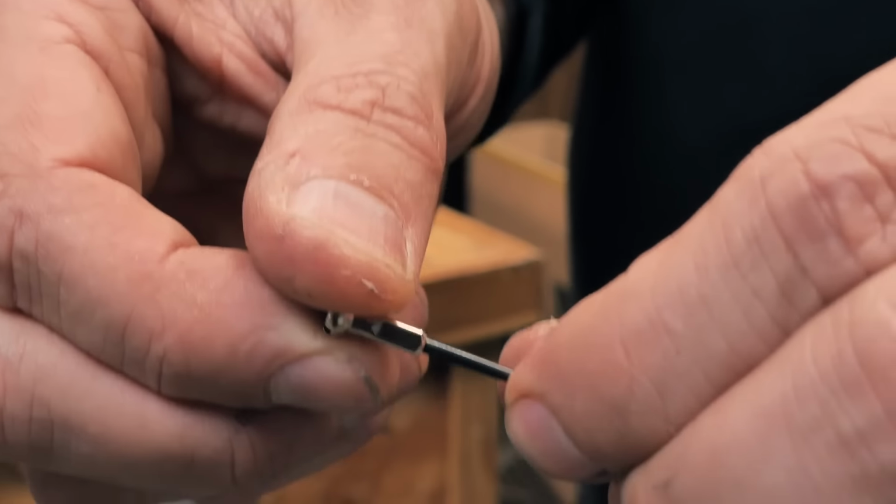This is a tensiometer. You can get digital ones, you can get ones that hook up to computers, but this is what most bike shops will have. It's what we use most of the time because it's very quick and easy to use. We have got some digital ones for when we really, really need them. This is quite simply going to measure the deflection, and you take a number off this. The important thing is 1, that they're all equal, and 2, that they're all within range.